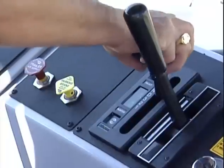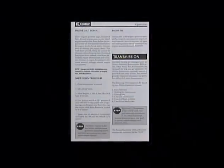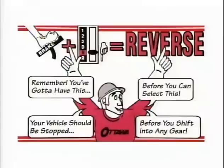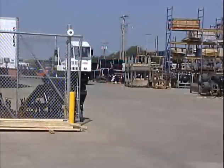For more information on proper gear selection and use of gears for engine braking, check the Ottawa Operator's Manual. Before attempting a change of direction shift — forward to reverse or reverse to forward — bring the vehicle to a complete stop before moving the shift selector. Your Ottawa gear shift lever has no P or park position. Every time you leave the cab, shift to neutral and set the parking brake. Never try to park while you are in a forward or reverse gear. Now let's go find a trailer.